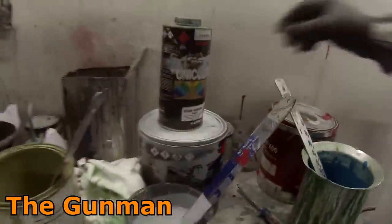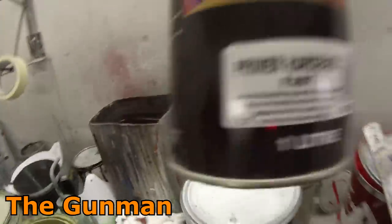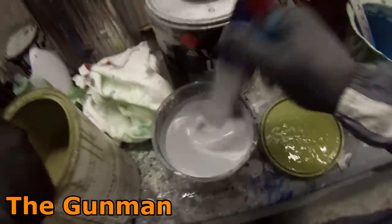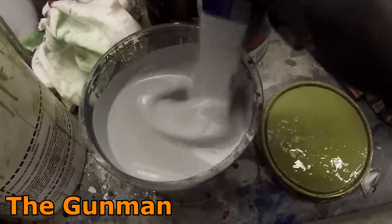I'm also going to be taking you through the paint work on this VL bonnet and boot lid. You can see I've done the prep work and got them hanging up in the booth, needing a prime. The product I'm using here is the Concept HS primer. I have been absolutely blown away by this primer — it dries well, it fills well, and as long as you've got your prep work done right, you won't get any excessive shrink back. It's also affordable, which is where it really gets the thumbs up from me.